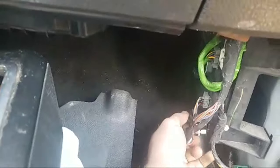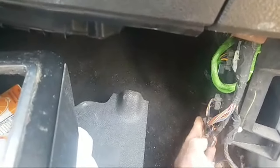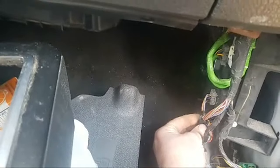It's just barely sitting inside the hole. That's a problem with this model F-150. Plug it back in and you can see it's not latching or locking in. So you've got to zip tie this piece back so it stays there and can't be pushed loose again.